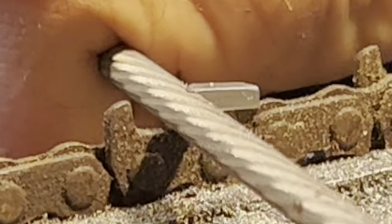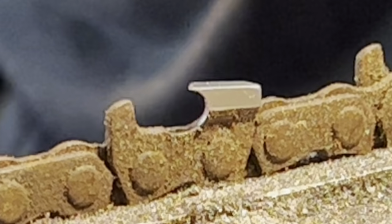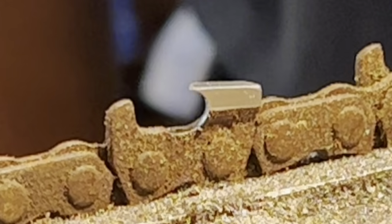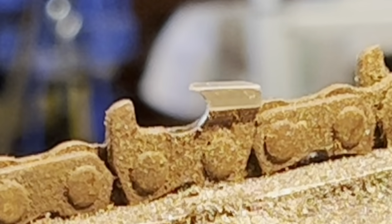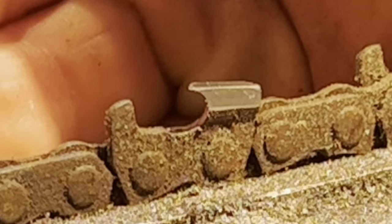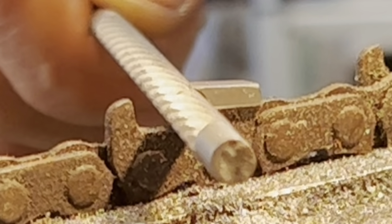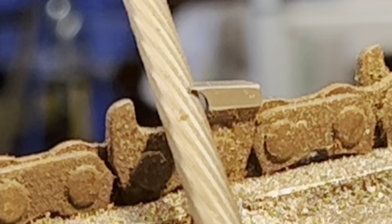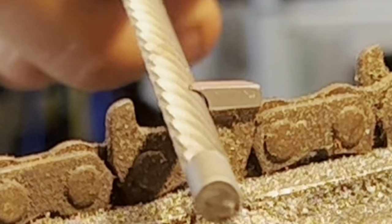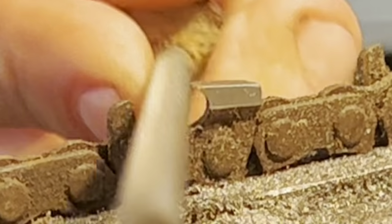Okay, so this is where you're gonna get edge retention issues. Now, I've seen it happen, friends. They get the gullet and they do that. You see that right there? You see what's going on, right? Well, the top of this tooth has not even been touched. You've completely undermined the top plate. You see what I mean? So this happens a lot. Now, look at the file. The file's even, right? Because it's grabbing the top plate.